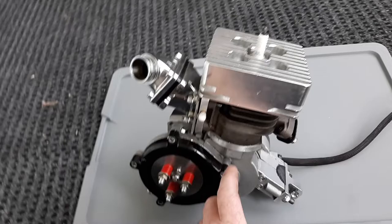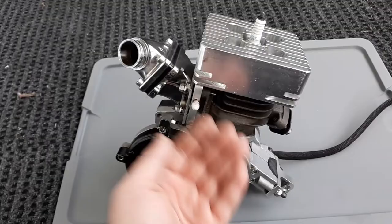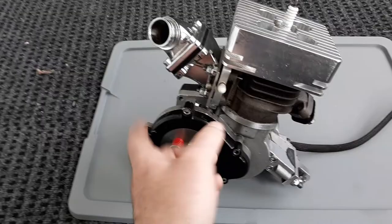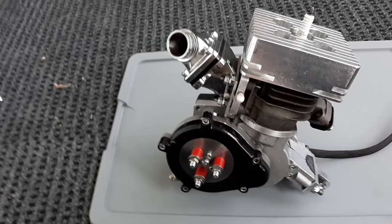I haven't had any problems with my crank, but I also balanced it. A lot of people aren't balancing these, so you're gonna lose crank bearings and stuff if you don't balance it correctly — it's not designed for the mass of that piston, especially at the RPMs this is gonna hit. So you are not gonna use a standard clutch. A lot of people are just shoving these on bottoms and you're gonna smoke that thing. You're gonna either have to buy or make one of these spring-loaded three-point clutches.